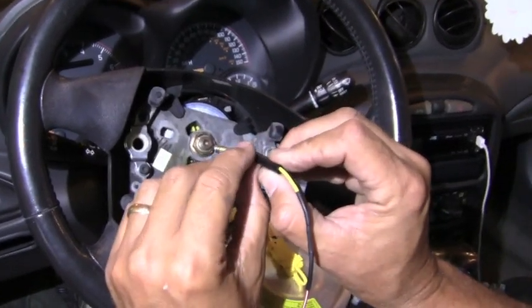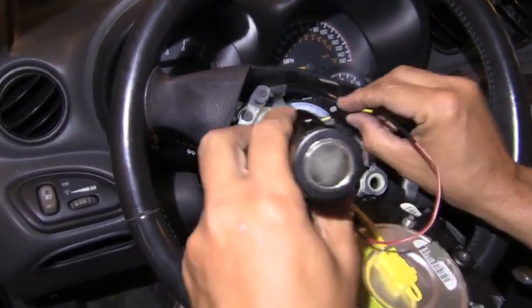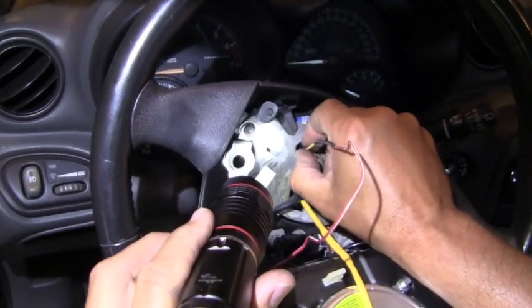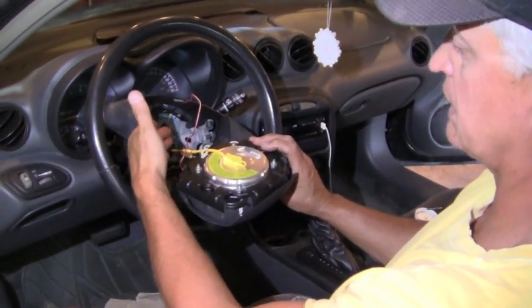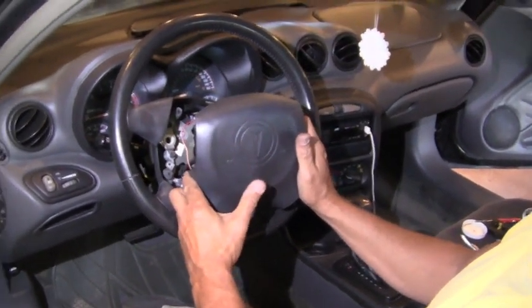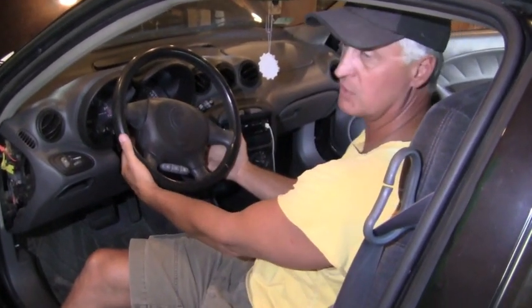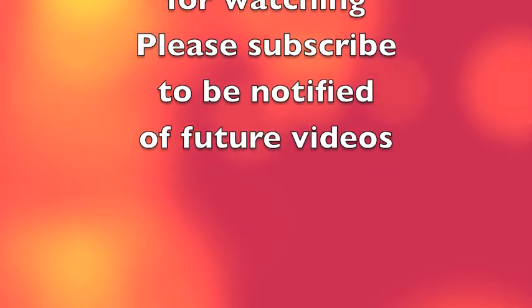Reinstalling the contact: you want to line up the little tab on the plastic — use a flashlight to see exactly where it goes — fit it down in the hole, give it just a little turn clockwise, and it's good. With our part back in place and soldered up with the new wire, let's see if it works — and we have a horn that works! Now all we have to do is put the airbag back in place, attach the two Torx screws to the back side, put the shroud on, and this project is complete.